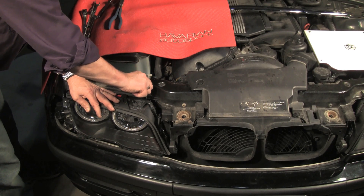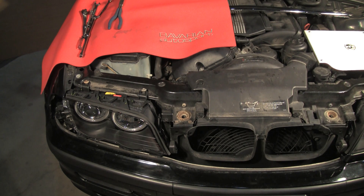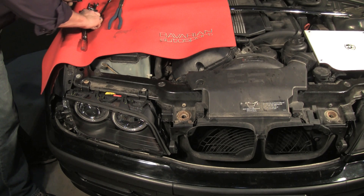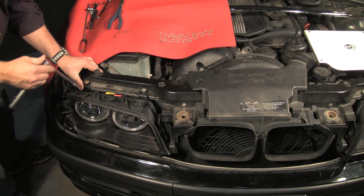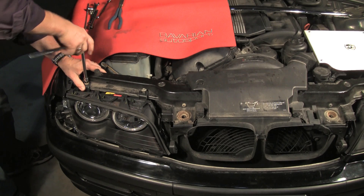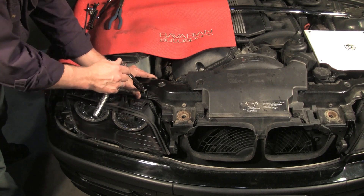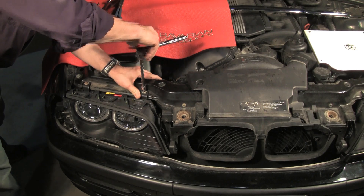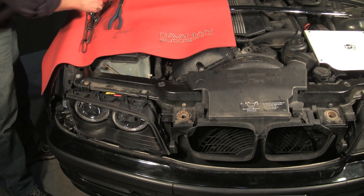You may notice there's some room for adjustment here in how the headlight sits. I'm going to take a look at the old headlight and notice how the screws were set — the marks that they left behind — and mimic that with the new one. So this one was pushed over here; just snug it up and I'll double check the other one. You can adjust these if you find that they're not quite in the right place after you have the parking light in place and you've closed the hood. We'll tighten up the two 10mm.